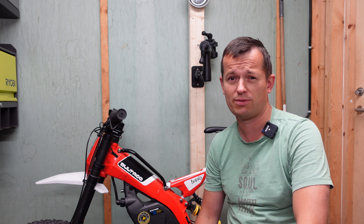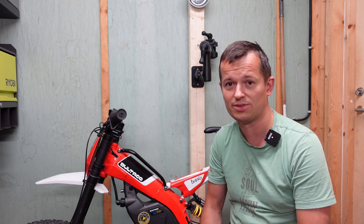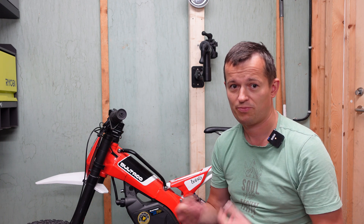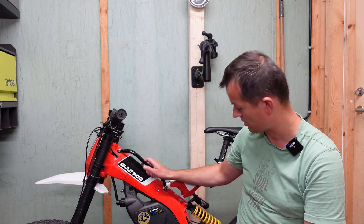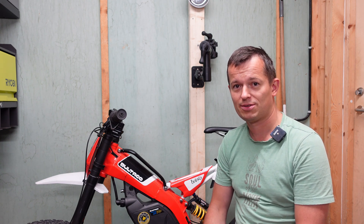Okay guys, short summary. I took this bike for a ride — I was reaching around 55 to 60 kilometers per hour, so it's not bad; it's quite a fast machine. What I don't like is it doesn't come with a PAS — a pedal assist sensor — so you can only operate it with the throttle. For me that's a disadvantage; I prefer to have a torque sensor like in CYC motors, where you can choose how you want to ride, either like a motorcycle or a mountain bike — EMTB. But in general this is a very good, solid, sturdy machine made for very hard terrain. So if you want to buy one, I can recommend it. Okay, that's all from my side. I hope this video was interesting for you — enjoy the season and see you in the next video. Bye bye.